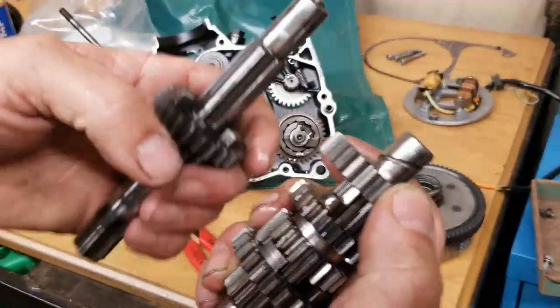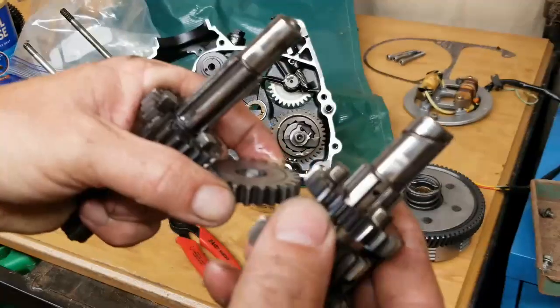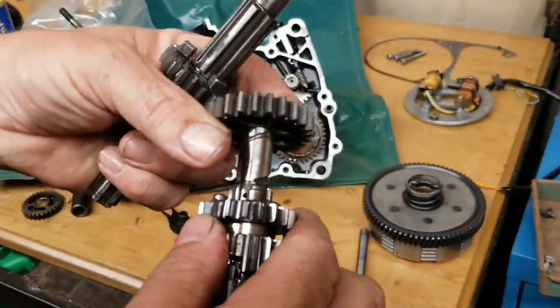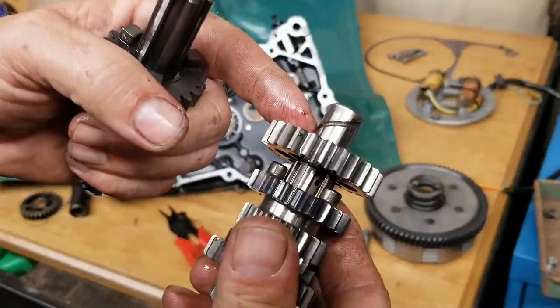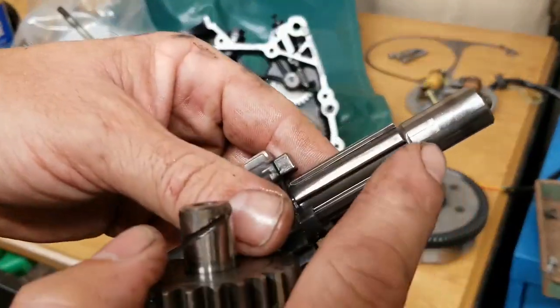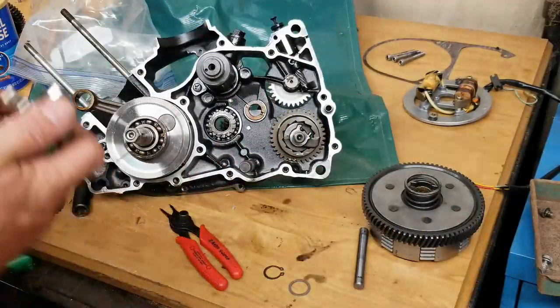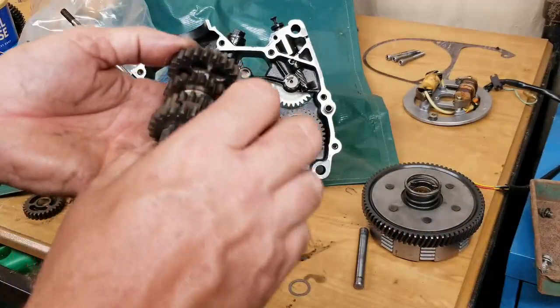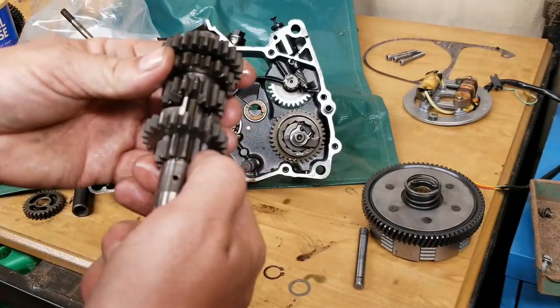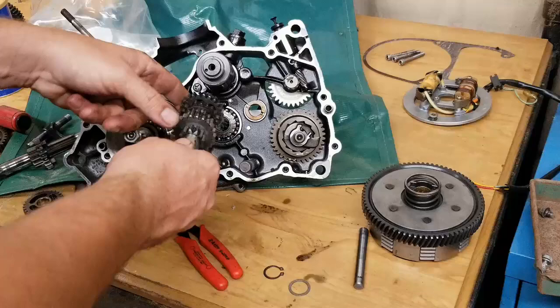the shaft going into it, you can see right here on the end, they're the same length, but you can see the groove all the way around it. That is a good quality shaft right there because it has an oil passage where this one doesn't. Notice how this one has a wear mark, this one doesn't. So this one's going to give better lubricity. I can't pronounce that word. And of course it's got oil holes right here for the bearings.